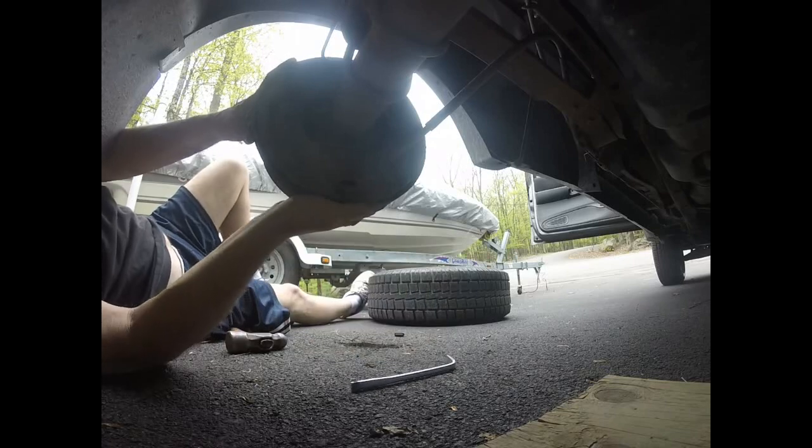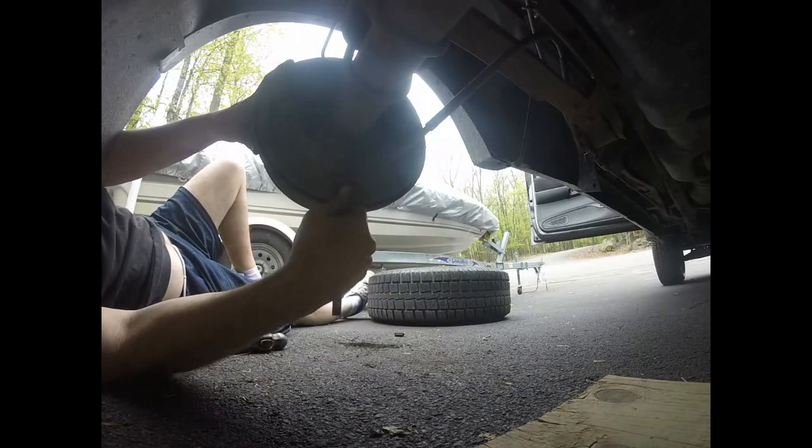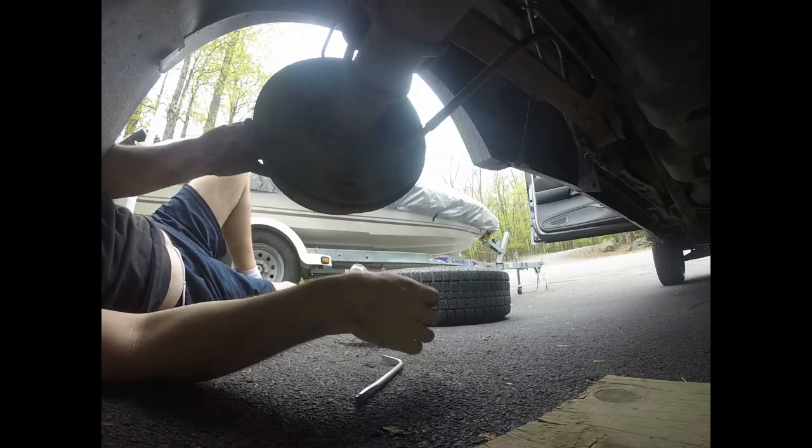Brake spoons aren't expensive. They're like 10 bucks. Go to your local AutoZone, you can probably get one there. Doing brakes, you need some specialty tools. Also, if you have an emergency brake on a drum type that isn't working, this will make your emergency brake work better too.